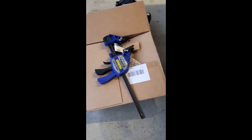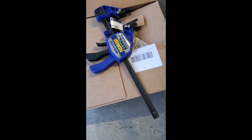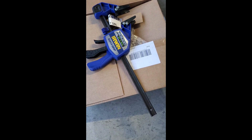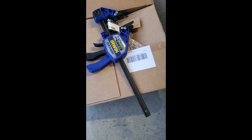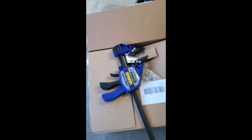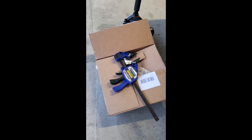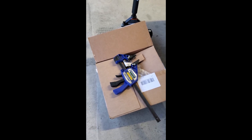One last tip about the Ranger lift: with these flush-face hydraulic line connectors, if you get any pressure in the line it can be a real bear to connect or disconnect them. The answer is this little tool right here — the Irwin Quick Grip X1300M. You just put the two ends of your connectors in there, squeeze the handle together, and it compresses them, making it as easy as possible to connect or disconnect those hydraulic fittings.